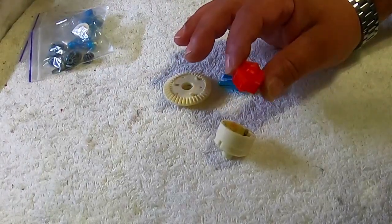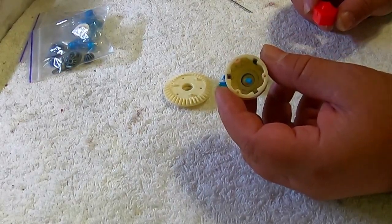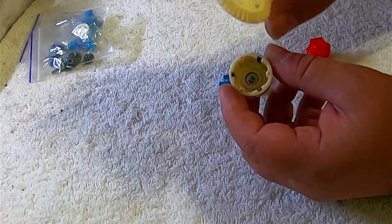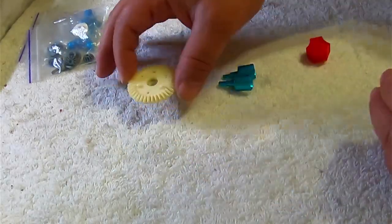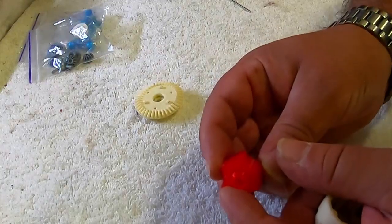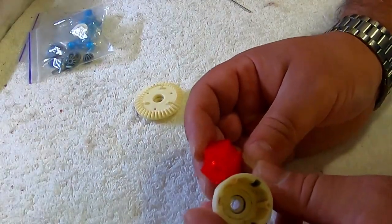And then all you do is take all your gears out of the diff housing itself, all the spider gears, everything. So all you've got is the empty cover, and then the ring gear that goes on the other side. Essentially these pieces fit into where these pieces on the diff here fit into the diff housing cups. So essentially this goes in here